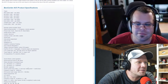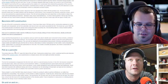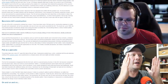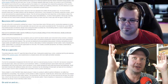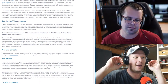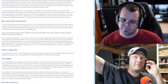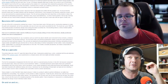Right. And just looking at some of the things on here, this has always been an emphasis of B&O too, to make a flat CRT. Not flat on the screen, but flat as in thinner. And this, like you said, is a 25-inch. Here's what I've always heard on why it's set at this 25, 26-inch size: once you get over that threshold, it becomes almost impossible without extending the tube length to get the focus, geometry, and convergence along the edges of the picture to look good.